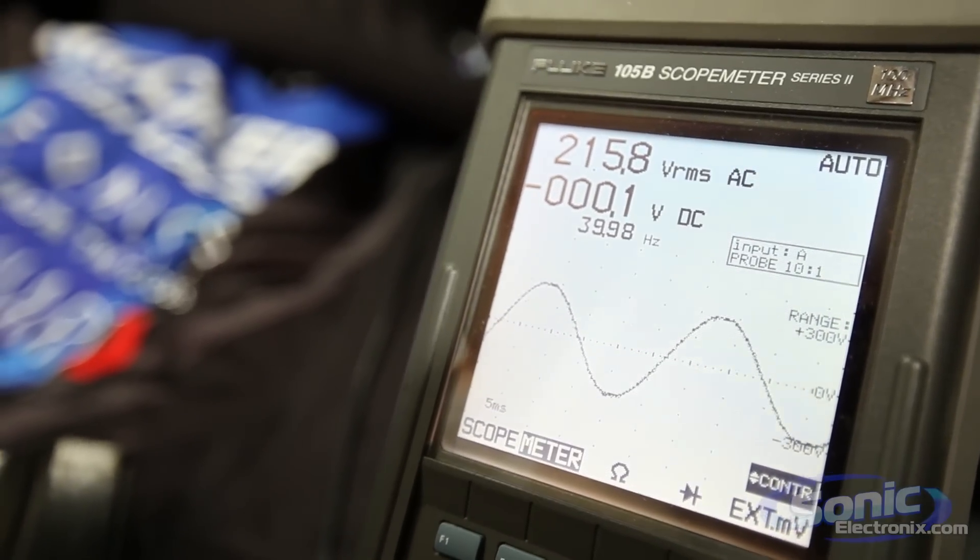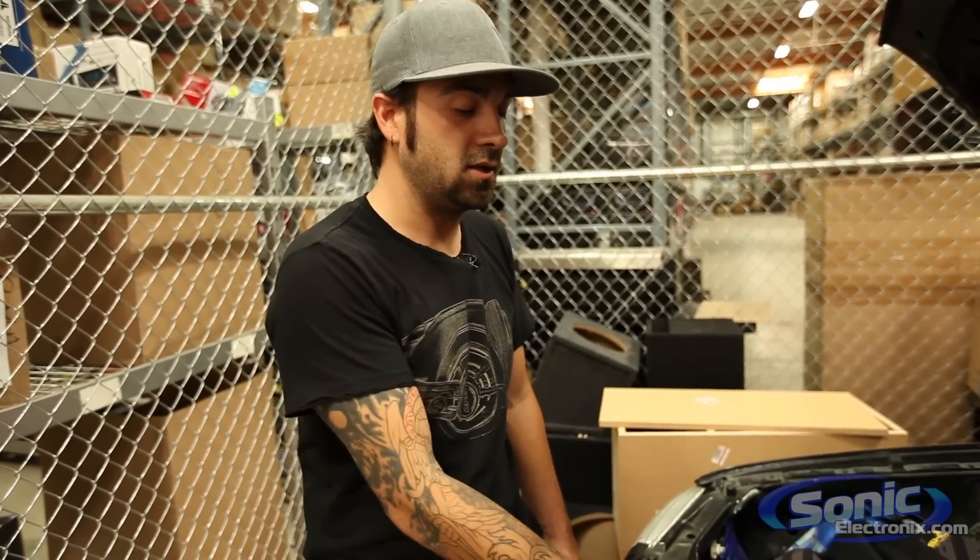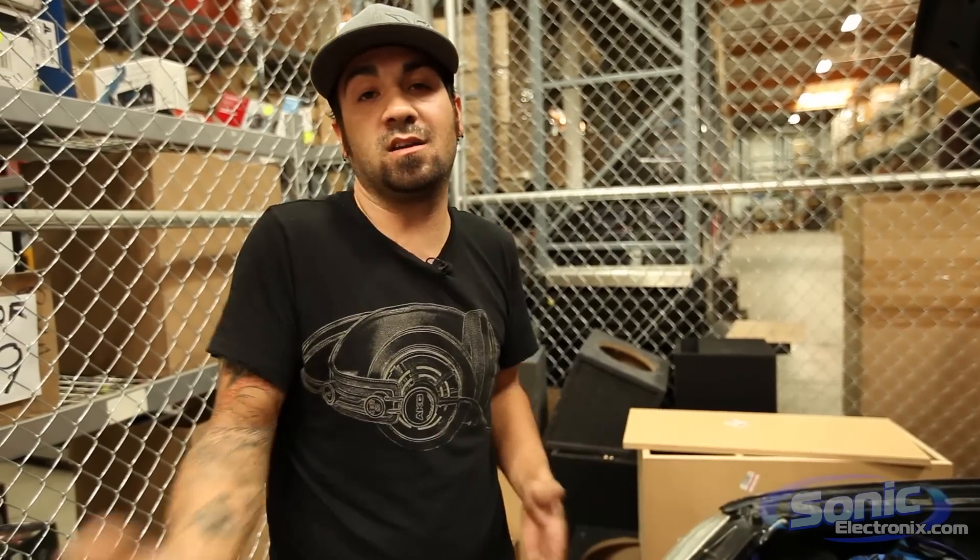That's why it's important to look at a better quality amplifier versus a lesser, inexpensive, overrated one. I'm not going to say this amplifier is a piece of crap — it will definitely serve its purpose if you only need a couple hundred watts. But if you're expecting 1100 watts, or even 500, you're not going to get it. You're not even getting the amplifier's rated RMS output. There's a big price difference, but be careful not to buy something just because it claims a million watts and the price fits your budget. You might be better off getting something of better quality with less rated power, because that's what you're going to get anyway. Thanks for watching — hopefully this helped. Alan, Sonic Electronics.